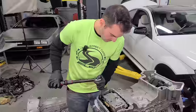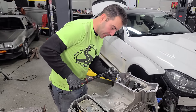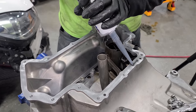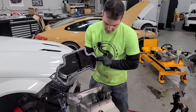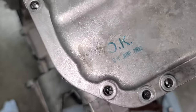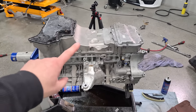Going around torquing all of these now. Oil pan number two is about to go on. I'll lay down a little bead of RTV. Make the connection — we're sealing up this pan now, line up those bolt holes and start everything by hand. The last pan is going on. I just noticed — it says 'OK' on it with a date: June 2013. This was okay, and it's still okay. We are done for this evening — she's all buttoned up. Everybody's tired and hungry, so we'll see you in the morning.